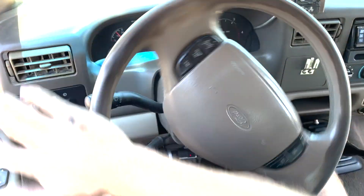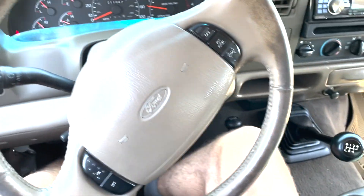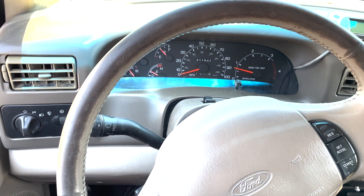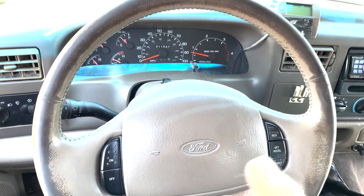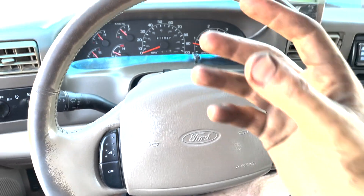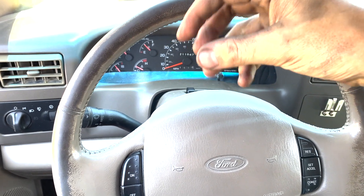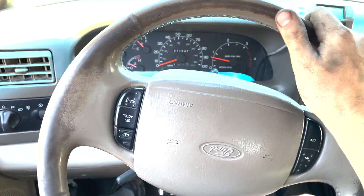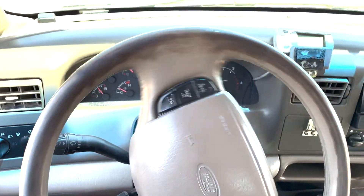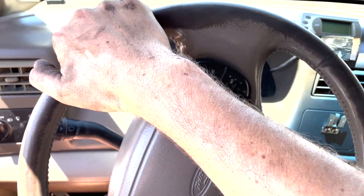We're doing the test drive and it is perfect. Steering wheel is super tight, very smooth. The brakes are firm, very firm. Don't get any whining from the power steering pump. The reason we replaced this — the gearbox was pretty good as far as tightness, definitely wasn't this good — but the reason we replaced it is because the seal where the pitman arm attaches had deteriorated. Over the course of about five miles it just gushed, and by the time I got home there was pretty much no fluid left. But you can see it's just smooth as butter now. Good deal.